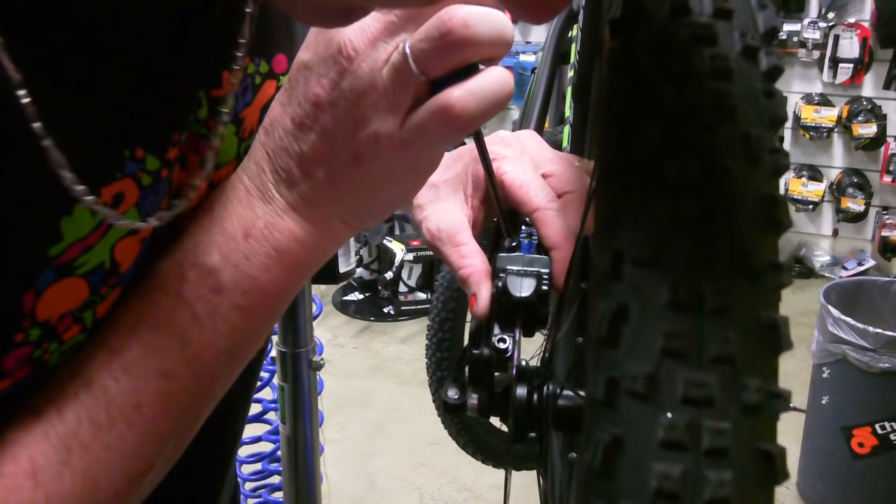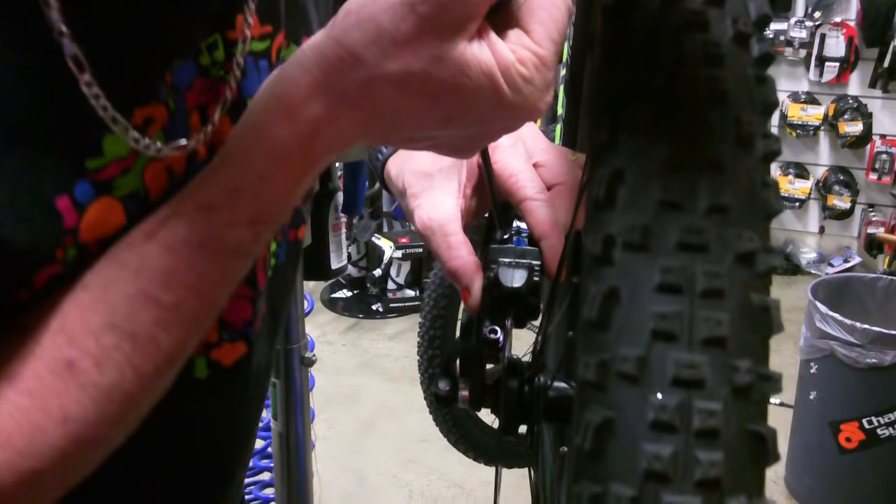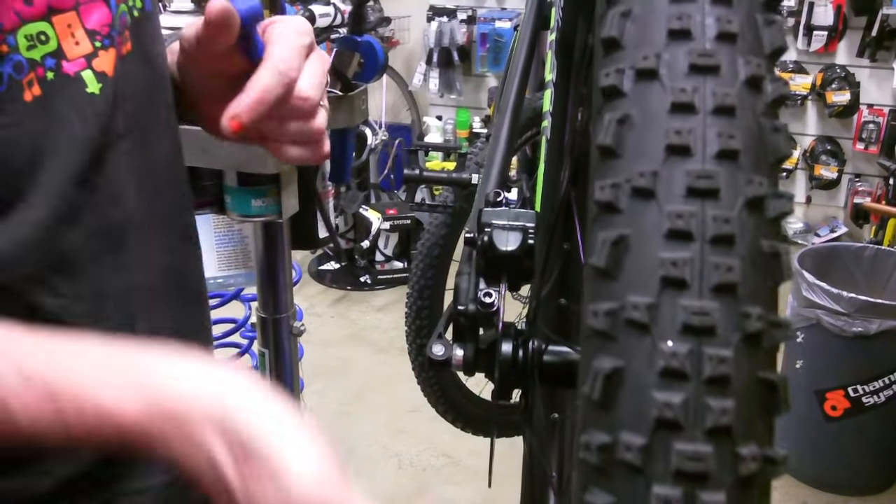So now you undo the top one, you pull that across a bit so that you can see it's sitting in the middle. You've got that bolt now and it's running right in the middle — and that's how you adjust the hydraulic disc brake.